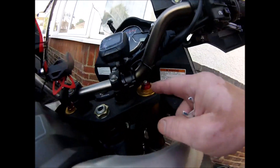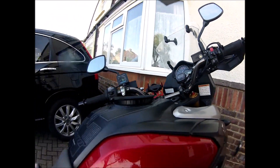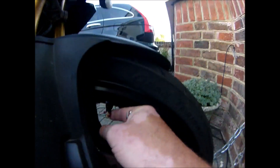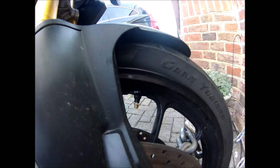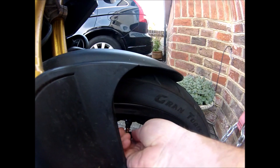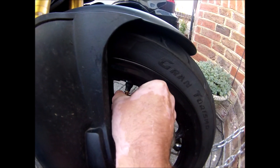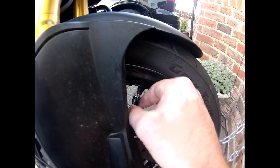It's got a handlebar clamp that I've clamped on and pinched into place, so that's nice and solid on there. Now I'm fitting one of the sensors which has got an F on it for front. You put a lock nut on the valve first, then you screw the tyre monitoring sensor to it, then bring the lock nut back down and pinch it on.